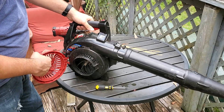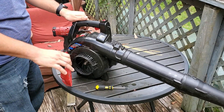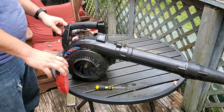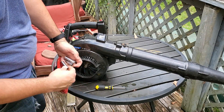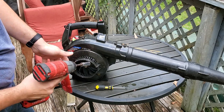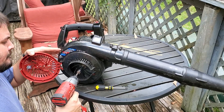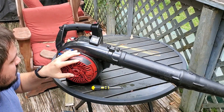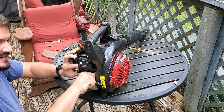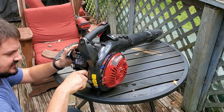I'm gonna see if I can get this drill to spin fast enough to try and start it — when you pull the cord you've got that spinning, so this is just the other side of the engine. It is an impact drill so I'm not sure it'll work; it may just hammer because it can't spin it, especially when it hits compression. It tries, but the hammering effect just messes it up. I did add some of my mixed fuel — may need to put a few drops in just to get the tank to actually mix.